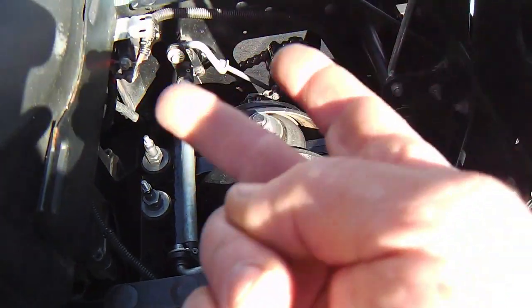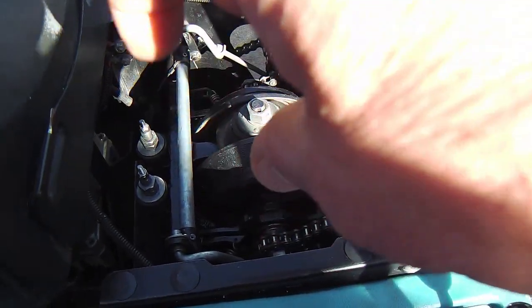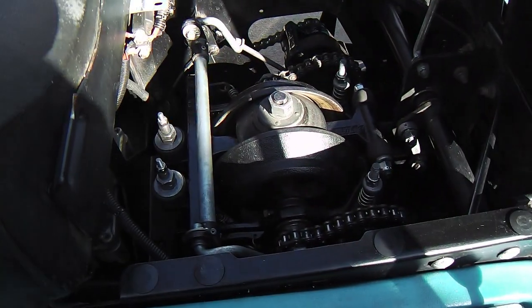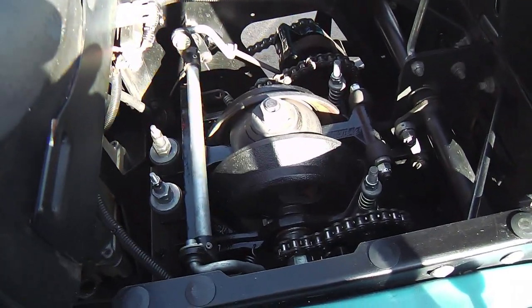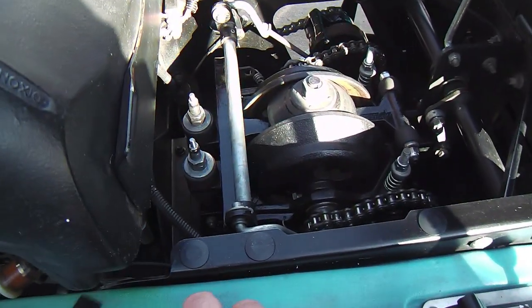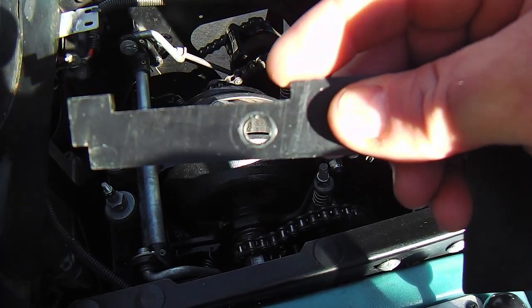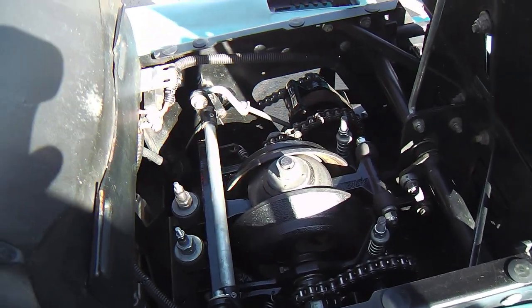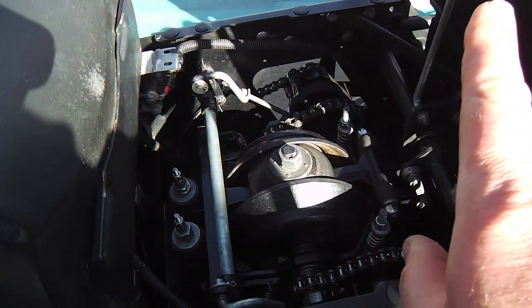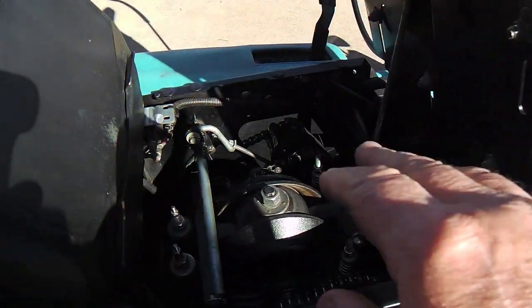and they didn't go back in the exact same way that they were, because there's two little prongs and they leave little indents, and I purposely tried to make it so that they wouldn't land on those same spots, because they were probably better off not being in a fresher spot. But anyway, you can set them both identically with this amount of space or compression, and what you could end up with, like I did, was on the right side a more torquey feel, a more responsiveness at these levers when you push it forward, and I like that.